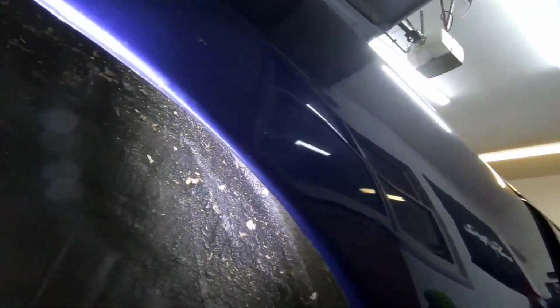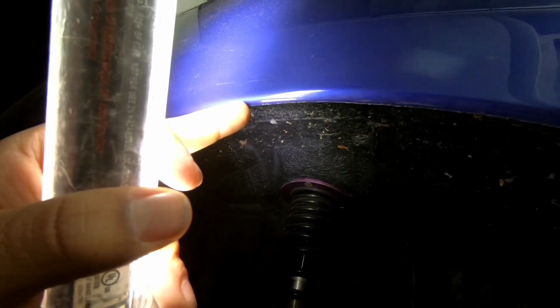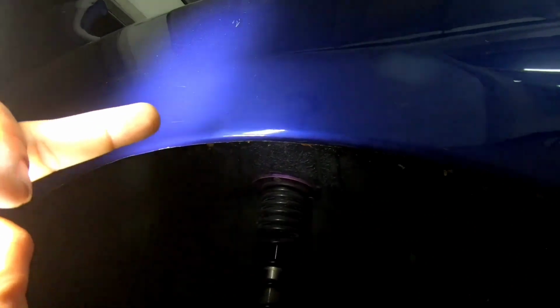Okay, so I think this is where we're going to stop. And the reason I'm gonna leave it there is because you can see this lip is very thin, but I still have to prime and undercoat the inside of it. Well, right there on the very edge, I'm gonna have to do that as well, just because that's the end of the metal that's painted on the car now. So scuff it, etch it, and paint it with undercoating. So there'll be a very thin layer of undercoating right here, which is fine. You won't see that at all from the side or the top. But if I keep going to where there's no edge, and the edge is the outside of the car, then it's almost going to be impossible to have the undercoating cover every piece of exposed metal without it being visible from the outside. So like I said, I'm going to stop it here, and we're going to make that adjustment on the coil, and hopefully that's good.